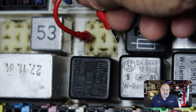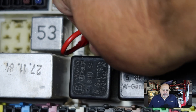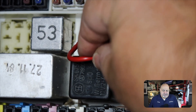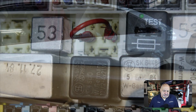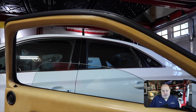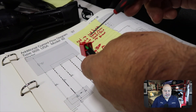Here I am literally trying to fat-finger my handy-dandy jumper wire into pins 30 and 87. Keep in mind I'm underneath the passenger side, underneath the glove box, trying to do this. Sure enough, when I plugged in my good power window switch, the window was able to raise.